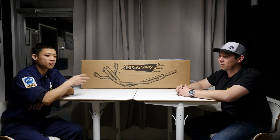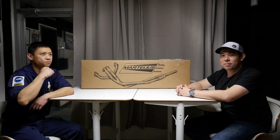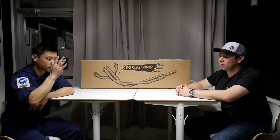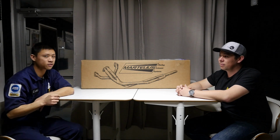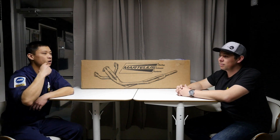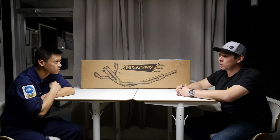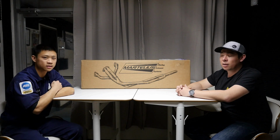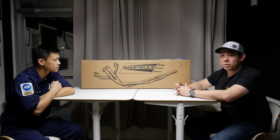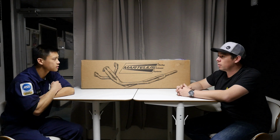During my time, if you saw the original Group A up to right now, the number one runner now clears the oil filter, and they got it so it clears the frame rail and the steering shaft on a left-hand drive car. Now the units are in stainless. They keep taking our input and improving the product for all of us. Oh, and we have the O2 sensor relocated now, so it's plug and play. Back in the original days, they required people to cut their O2 sensor and extend it. So this all makes it a lot easier to just bolt on and go, right?